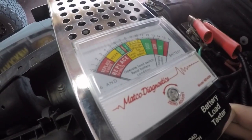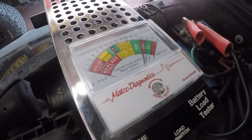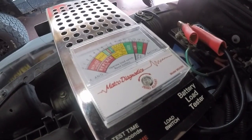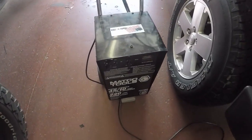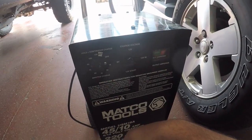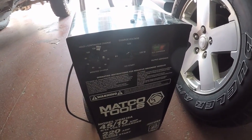I think we could try to charge the battery a little bit more, but in this case I believe the battery is probably pooched. We'll go ahead and charge up the battery — put a charger on it — and then do our parasitic draw test afterwards. We got our battery charger hooked up, giving it a 30-minute timer on 12 volts high, and we'll do a battery test afterwards and let it settle for a minute or two.